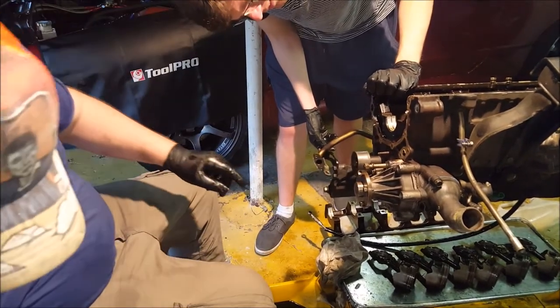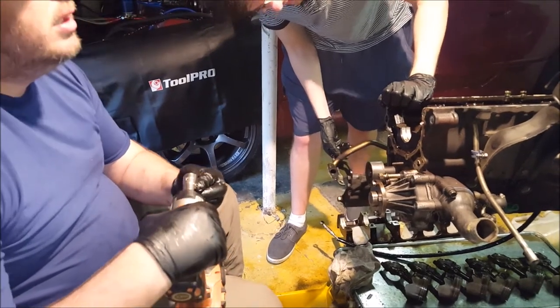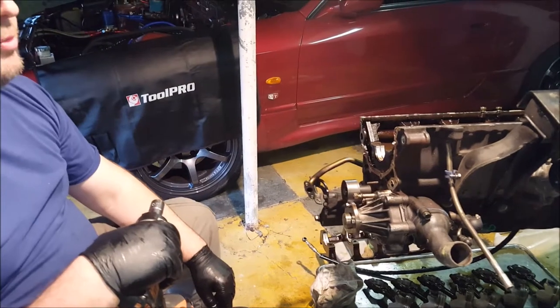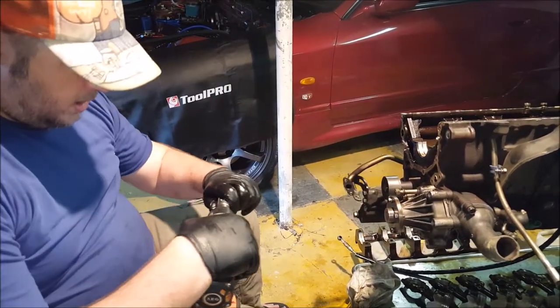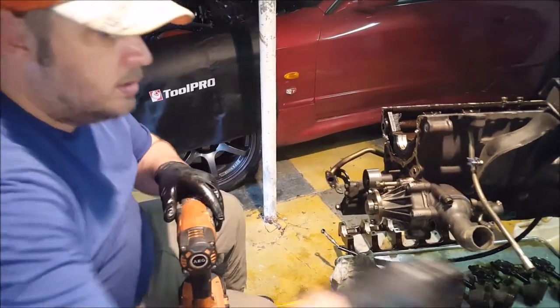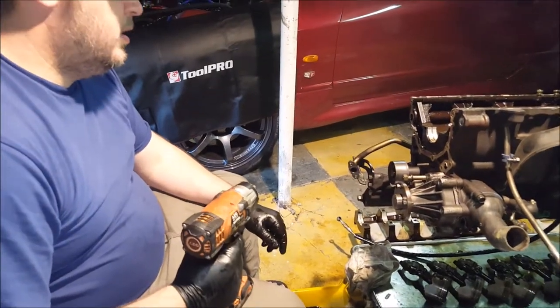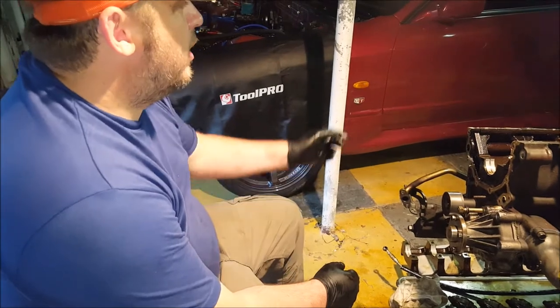I imagine a thinner wall socket. But who designed it like that? I don't know. Maybe it's not the original bolt. Check the top thing, bottom drawer, sockets. See what you got. Maybe they got a thinner wall 17. I've got a 3/8 here, but it's pretty thin wall and stuck on, so I'll go around. Okay. It's a half inch drive. Yeah, I don't have a 3/8 inch drive.